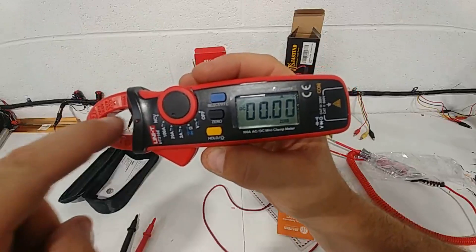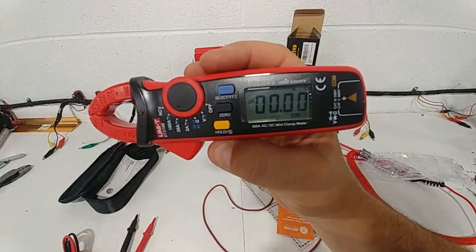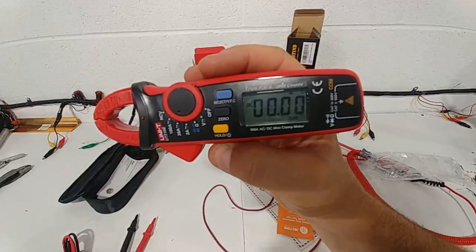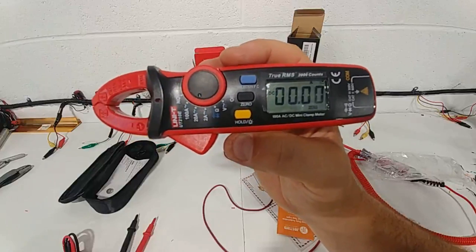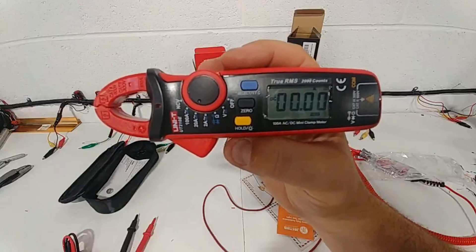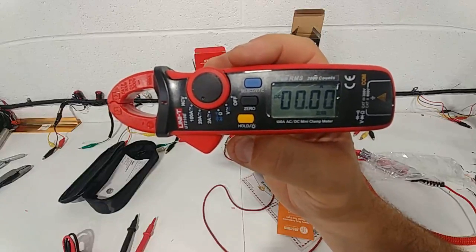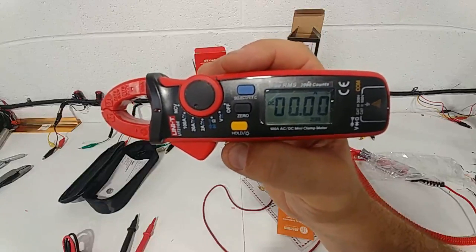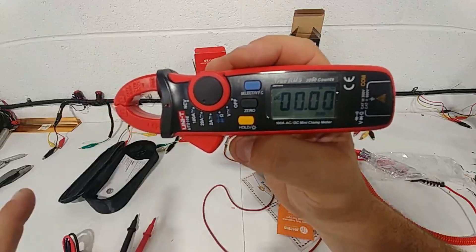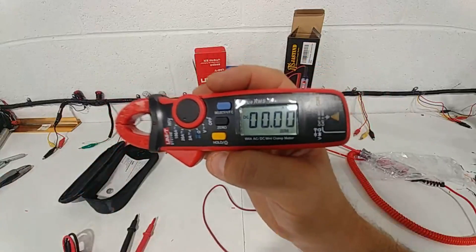I was able to verify that, and when I found the high current I hit hold, took a picture of it, and sent it to the client and said this is your problem right here. This wire should not be drawing anywhere near 29 amps and this is why we're having melting problems. He thought maybe the lights were to blame. Then I isolated it back to the short circuit, corrected the short, and the amperage draw dropped down to about 1.5 amps and the lights worked perfect. He did not need new lights or new wires — he needed a repair, and it took this meter to easily find it.